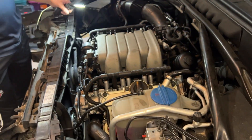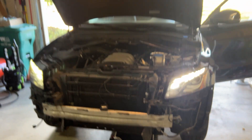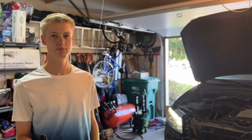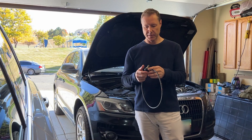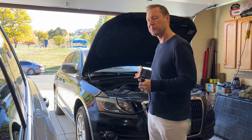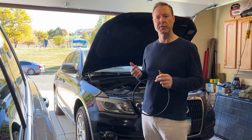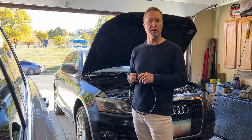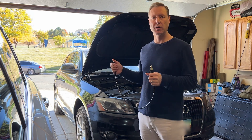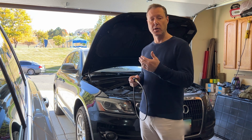I don't see any water squirting out — looks good, put the bumper back on. A couple of final thoughts: it sounds much better. A couple of days later we've done five or six cold starts, since secondary air injection only kicks in on cold starts. We cleared the code, started it, ran it for a bit, then waited for another day. The code hasn't returned, so I presume it's good.